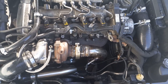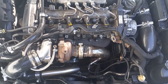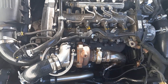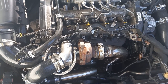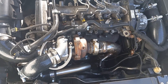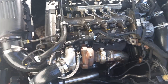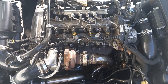When you give it full throttle, we are getting a slight over-boost at about 3,500 RPM. That's not unexpected, because this turbo has a much lighter shaft and a billet compressor wheel, which is lighter, and the inertia of the ball bearings is much less than journal bearings — that's why it accelerates much more quickly. We're going to have to do some adjustments to the mapping to prevent that over-boosting, because over-boosting is not something you want to ignore — it destroys turbos if you let it run for too long.